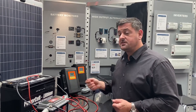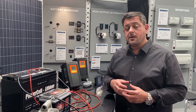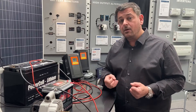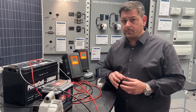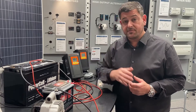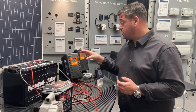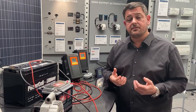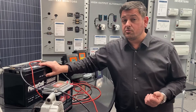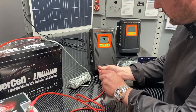It really is as simple as that. We've got a positive input to the DC-DC charger and a positive output from the DC-DC charger. The unit has two modes: it will either fire itself up and run automatically, or there is an additional terminal inside the unit that you can connect to the ignition switch. In the case of a Euro 6 vehicle, you have to connect the ignition, so when the ignition switch is on it arms the unit, and when it senses that the power in the engine battery is sufficient, it fires up and starts charging your auxiliary battery in the back.